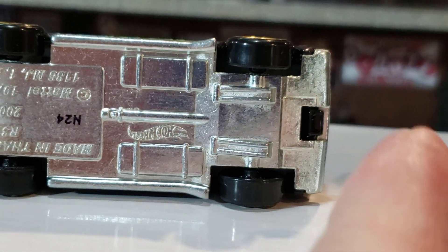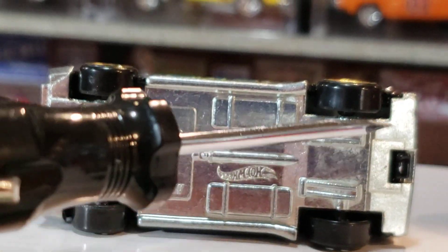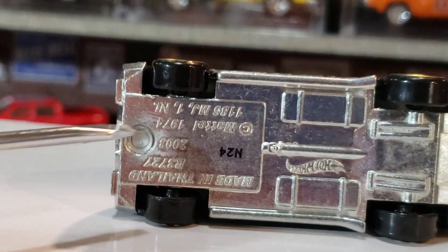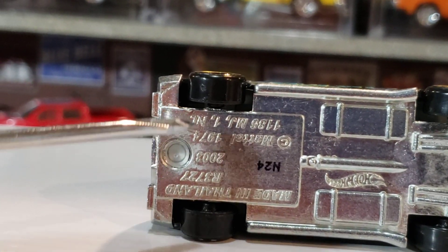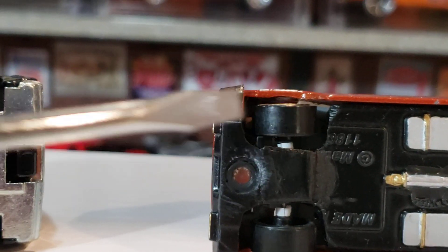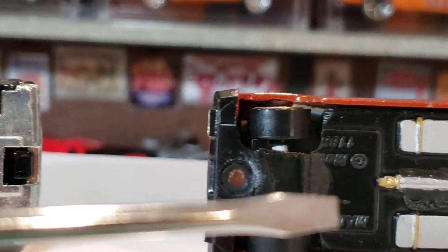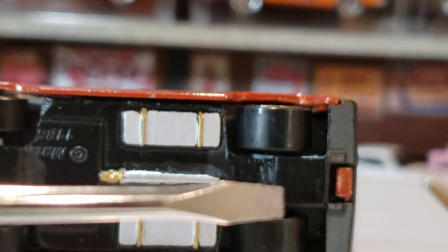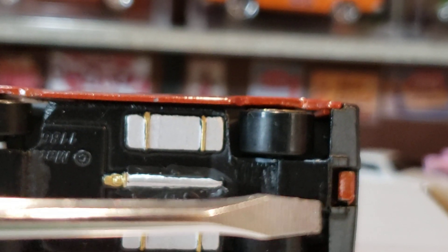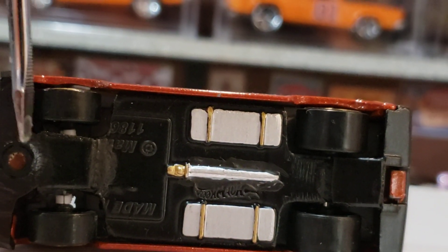I had to chop all of that out. And then I had to cut it right across there and right across there. As you see, I lowered it like three-sixteenths of an inch. Made my own little piece to hook them back together right there. Same thing in the back — made my own little piece right there to hook them back together. Glued them, gusseted it from the bottom, put another gusset piece to hold the metal back up.